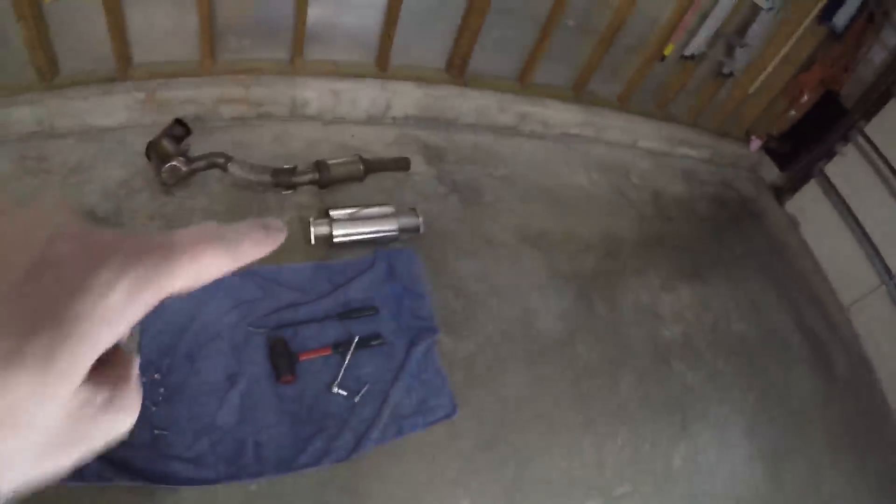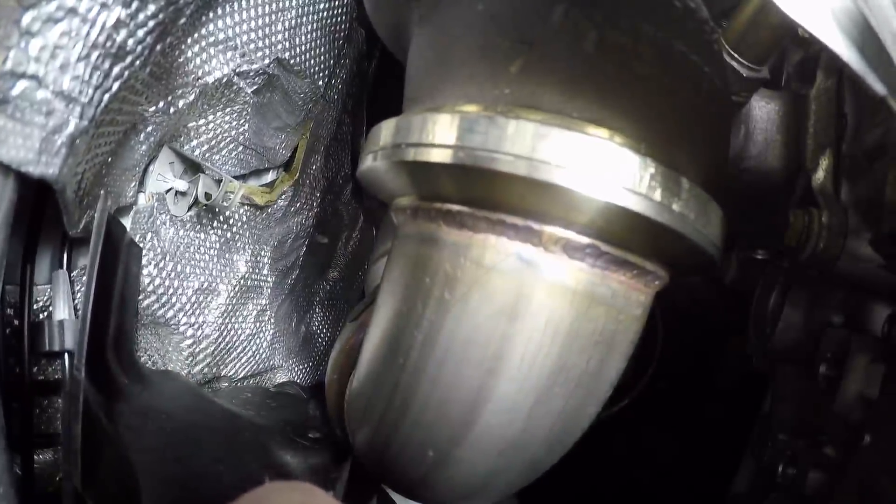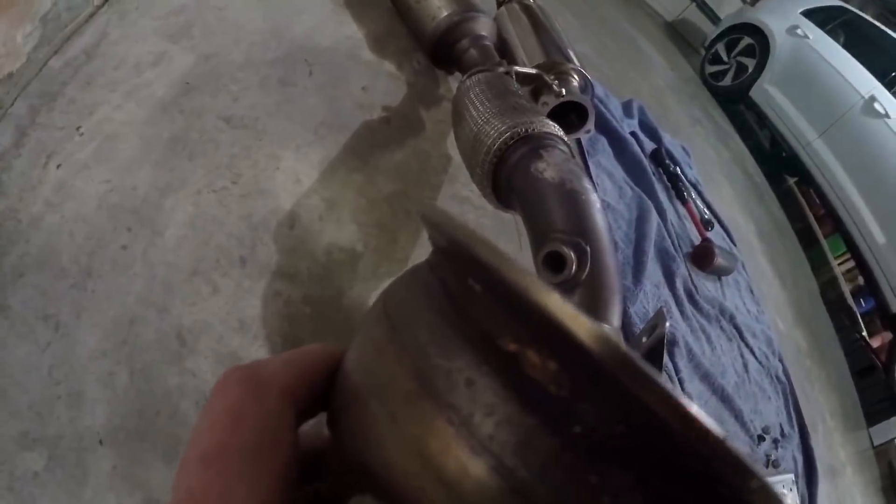I'm going to go ahead and start tightening all this stuff up, put on all these bolts, get the front done. Then the next big question is: is the resonator going to bolt up right and be a nice fit? So far I'm already pleased - I didn't expect the top half to fit that well. A lot of people have questions regarding the clamp. Study the thickness of that UR flange - the stock one is a lot skinnier, which means your clamp is not going to be as tight. The UR flange is about twice as thick.